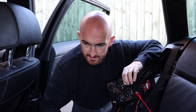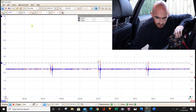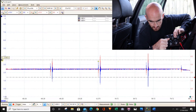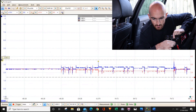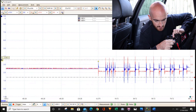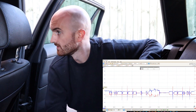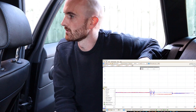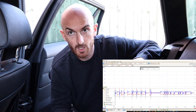I'm going to reset these markers to where we had them before — 1.4 volts on CAN low, 3.6 volts on CAN high. I'll dial this back up now before my battery on the car dies. Starting with the 1-ohm increments: 1, 2, 3, 4, 5, 6, 7, 8, 9 ohms. With 9 ohms resistance between the two wires, we kind of get some CAN communication back. You can hear it's still not happy, but the wipers have stopped. We've got run-flat tyre monitor and DSC faults on there — still not happy, but the wipers have stopped going off constantly.